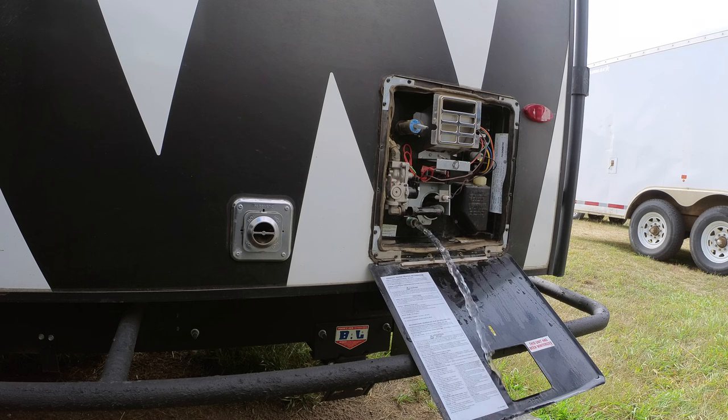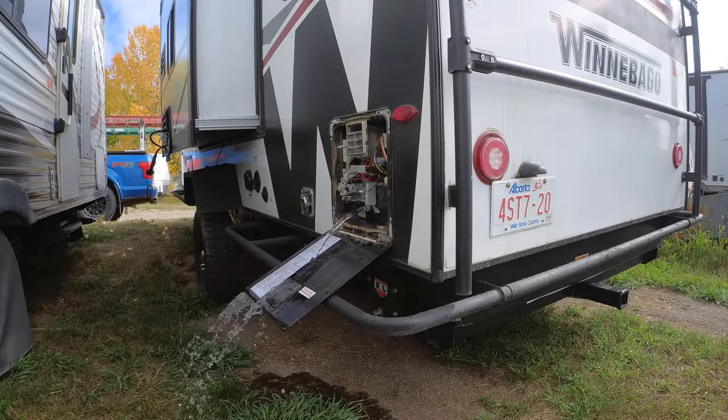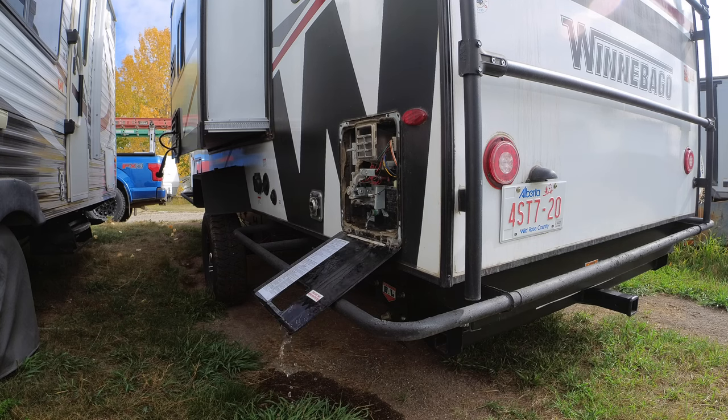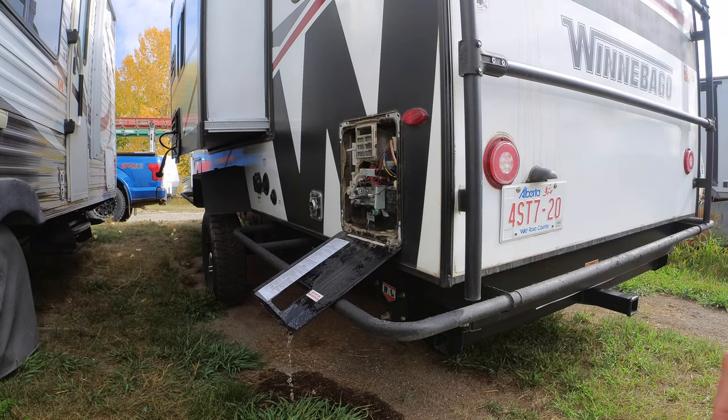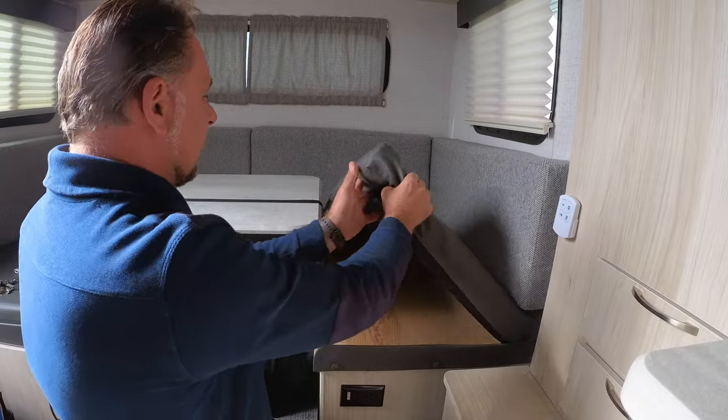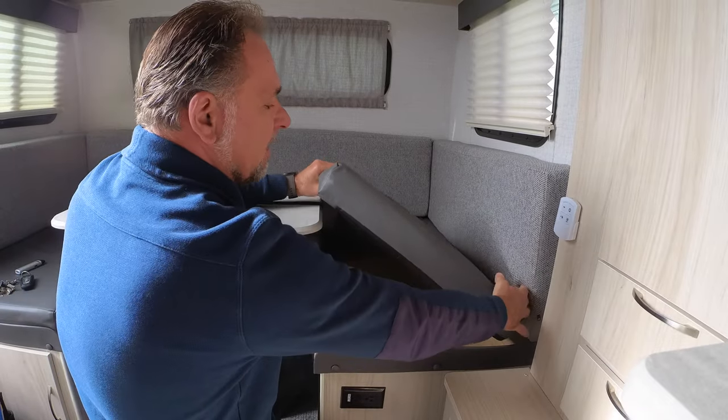Make sure not to lose that drain plug. That will take a few minutes to drain — there's not that much water in there. It's almost finished draining. I'm going to leave it open and come back to it after I winterize everything to put the cap back on. You want to leave that open so the water completely drains out. Conveniently, the trailer is tilted the right way where it's parked. Next, I'll have to get into the location of the hot water bypass, located here under the seating area.